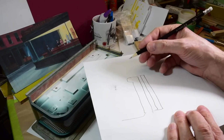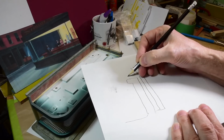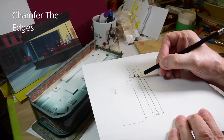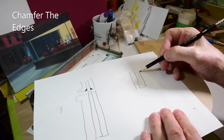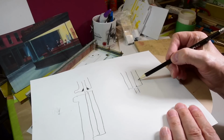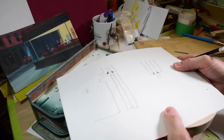For the top, it'll look sort of identical when you put the hood down. I would make sure that you have a good groove cut away right here on both sides, so that when the glazing goes up in there, it doesn't catch. I had a few problems with this. Say this is the top where the glazing goes up inside the fascia. When I was trying to get it in, it was catching here and pinching, and getting that full length and the curve to take that top piece was a real challenge. But then I did scrape it back. I had to sort of redo it there. But anyway, that's what I would do. That's the lesson I learned from that.